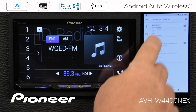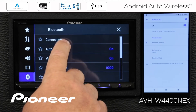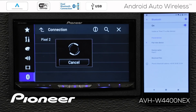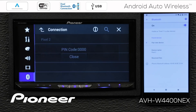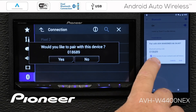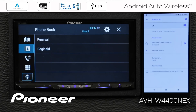I'm going to open the Bluetooth window so that the phone is visible to other devices, and I'm going to pair my in-dash receiver. Under connection, we'll choose the magnifying glass, and that will search for devices to pair. Here's the Pixel 2 — that's this phone — so we'll choose it. That will create a pairing request with code number 018689. Same number over here. So, we'll say yes on the in-dash receiver and pair on the phone. And now the two devices are paired.